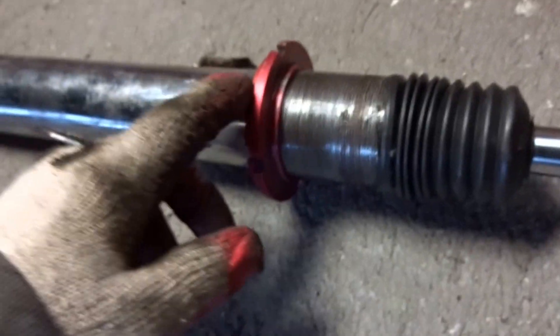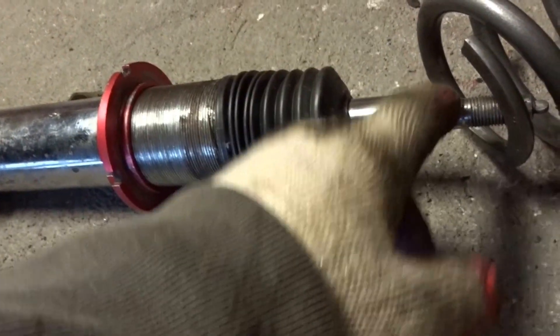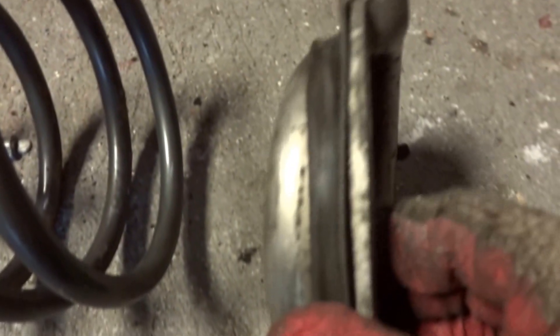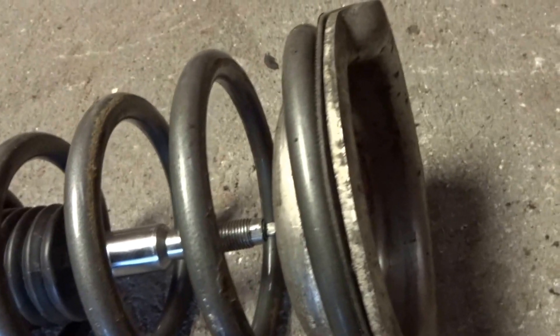When reassembling the front strut, the easiest way is to put the adjustment collar all the way to the bottom so you have much more room to get the shaft to stick out so you can put the nut on. It's very important you do it in the right order. First thing that goes on is the boot — this little boot with the bump stop goes over. Then goes the spring, sitting onto the adjustment collar all the way. Then goes this piece from the stock suspension with the rubber piece. Then this washer, which is very important because without it this part won't spin freely.